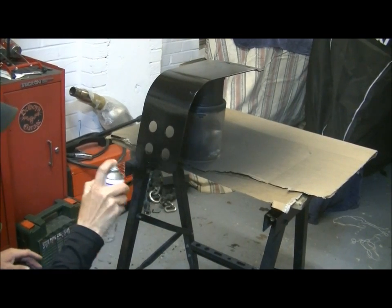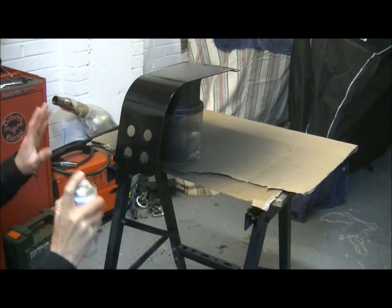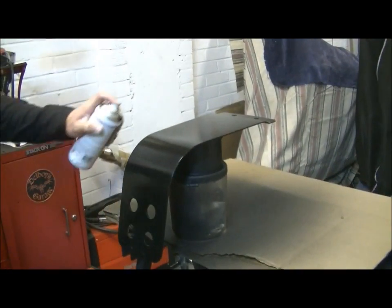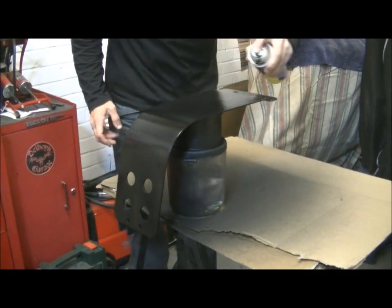While it's quite stodgy and porridgey looking, it's not going to run. When it gets real glossy, then it's the danger it can make a break for freedom and start sagging. And if it does, and you don't want that look, which you obviously wouldn't, I'm afraid you've got to wait till it's completely dry and rip it off and start again.